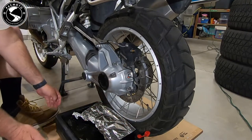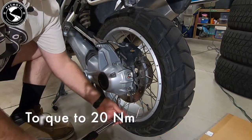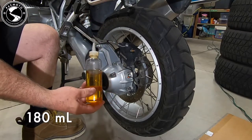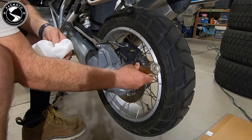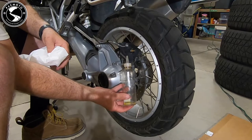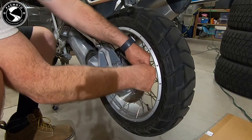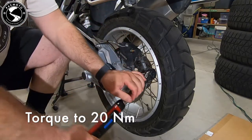I removed our dam and drain pan along with the old crush rings and O-ring. Let's torque the drain plug to 20 Newton meters. Now let's squirt in 180 milliliters of our 75W90 GL5 final drive oil — just going to sit here and nurse it in. 180 milliliters of final drive oil. I've put on a new crush ring. Remember, this is the six millimeter hex filler plug. Torque to 20 Newton meters.